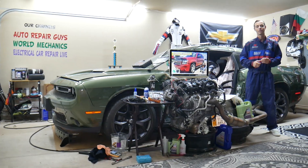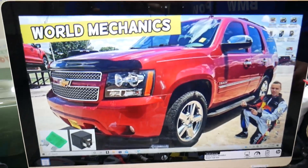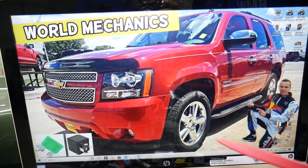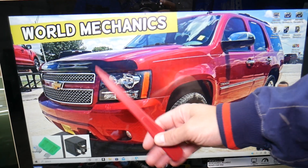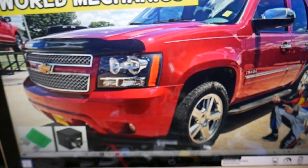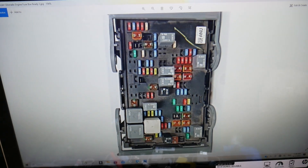So if the traction control light is on, we'll demonstrate on this Chevy Tahoe right here. The Chevy Suburban is practically the same vehicle — just a little bit longer — built on the same platform, so everything will be really close or about the same. You have three different fuse boxes; today we're working with just one that's right under the hood. Pop the hood open, and facing the engine on the right side under this cover, you have a fuse box. Open it and you'll find the main engine fuse box with a layout like the one shown here.